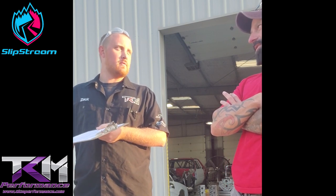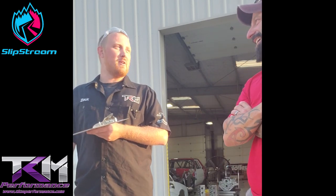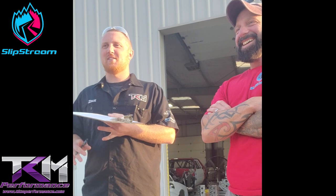Yeah, because I've got the full 3.8 coming. Gotcha. Jason should have that in a week or two. Okay, so the 3.8 going on there as soon as it gets back. So yeah, we'll want to do all that then. We'll want to switch over to main studs, switch over to the ARP head studs and all that stuff. Okay. All right.